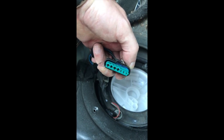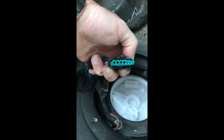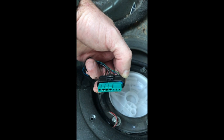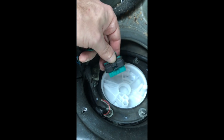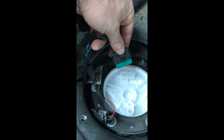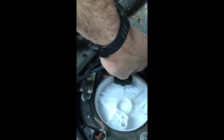I do want to mention at this point, if your water seal inside the connector, see that blue ring around this thing, is damaged, well then you may want to fish it out of there and trim it up and then delicately stick it back in there. It might make connecting this thing a bit of a migraine, but it's supposed to snap back on. Not in this case.